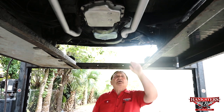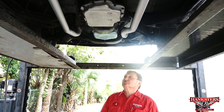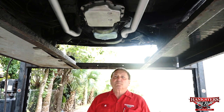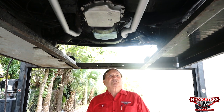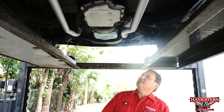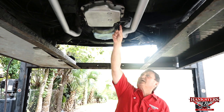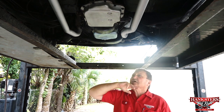I'm going to call them 2 1/8 inch primary pipes going off the standard cast iron exhaust manifolds, transitioning toward the rear the whole way to the two stock equipment type under chassis mufflers that would have come on this car in 1967. The tranny, the transmission, no leaks on the pan. A little tiny bit, not quite enough to drip, but there is some seepage, a little bit of wetness on the vacuum modulator on this particular car.